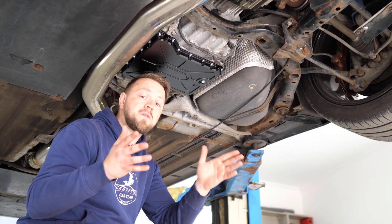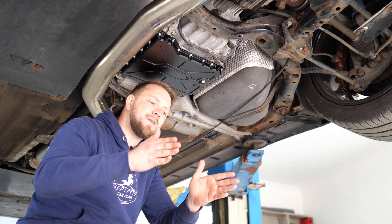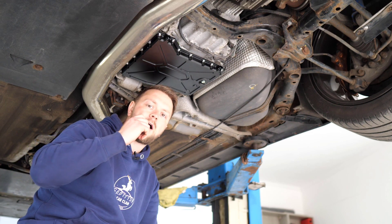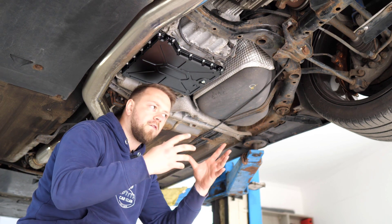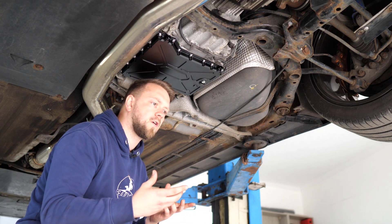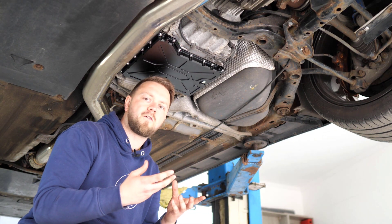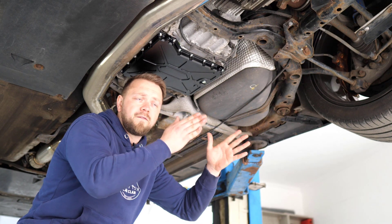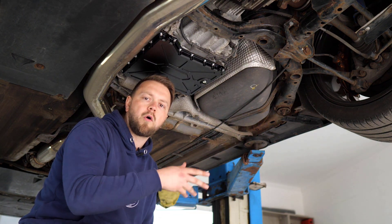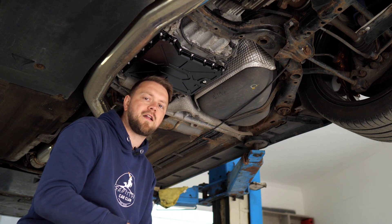Another interesting change between the CBAs and the DBA forward cars were the clutch seals. Although the parts look identical — so something must have changed in the manufacturing process or material — those earlier CBA cars were much more likely to blow out a clutch seal and leave the car stranded in gear.